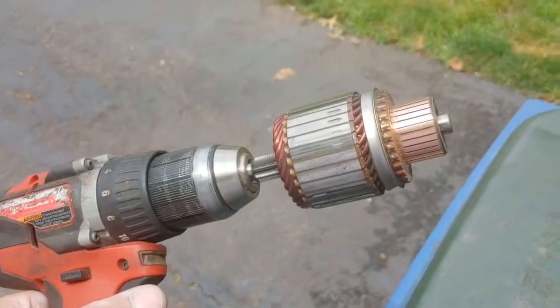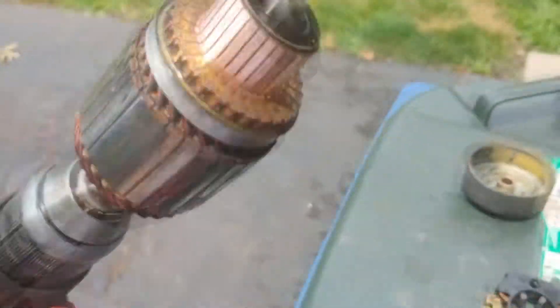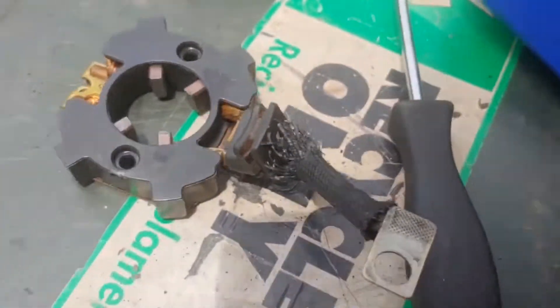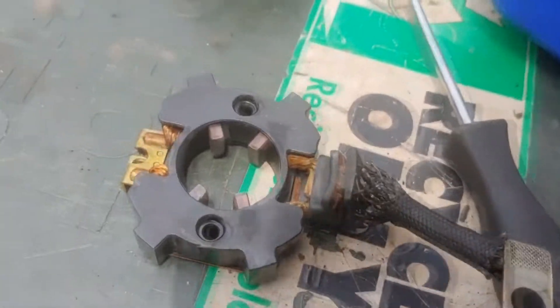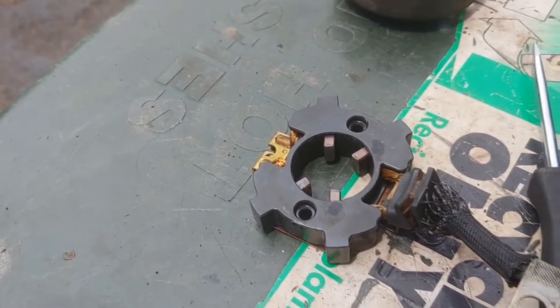Is this the right way to do it? Probably not, but I did it anyway. I used a little bit of fine sandpaper, cleaned those up, got the shiny spots off of there, got the burrs off of there. Cleaned them up, made sure there was no carbon stuck in the springs. Then clean the rest of this up, clean the inside there.